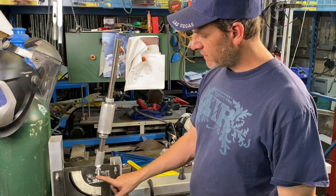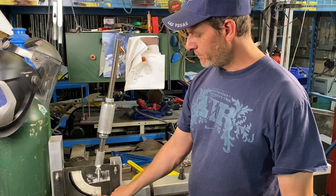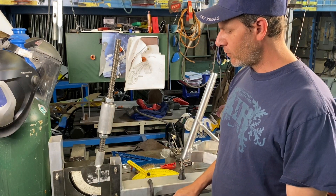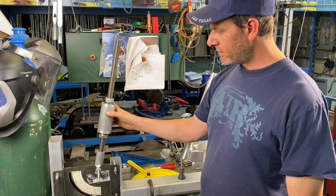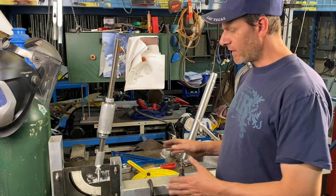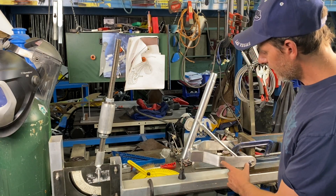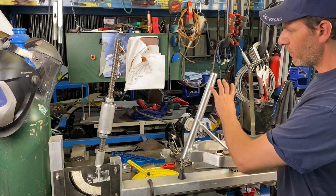We know that this here is our pivot point, and we have an angle or a protractor that shows us the angle of this front end. Usually I use this jig for building motorcycles — I put the headstock inside here, but on the rail is usually where I mount the engine because I want to square up the engine with the front end of the bike. This is a little bit smaller, so we're actually lining up the back arm with the front of the frame and tying both together.